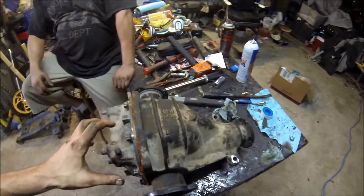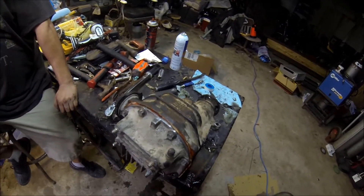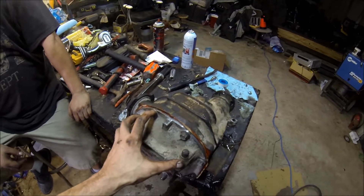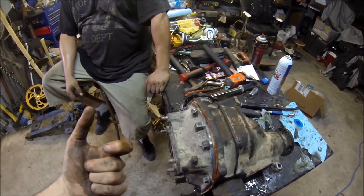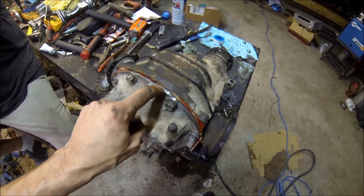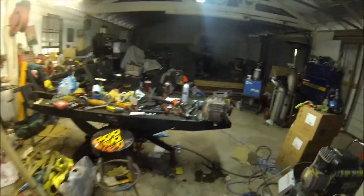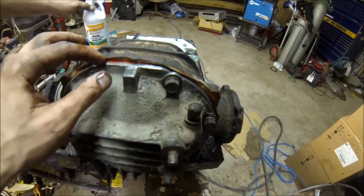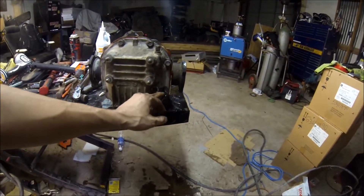Here's the finished product. Let's go through a little recap: we took off all these bolts, this pops out, these simply yank out. The old gasket was pretty much disintegrated into the cover and the diff, so I had a little drill with a little brush, cleaned it up real nice. As you can see the inside looks good. Welded the diff, put it all back together — it took exactly two quarts. Fill it up right till it starts to spill over and you're good.